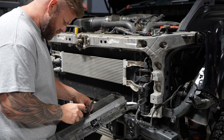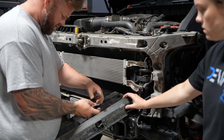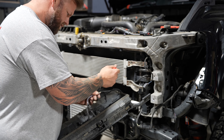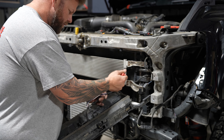Next, free the wire by pulling on the plastic tabs that hold it in place. You'll need to unravel the tape and cut back the wiring so you have enough length to reach the newly relocated device. We cut the tape all the way back to split the wires into two, so that we would have plenty of room to relocate.